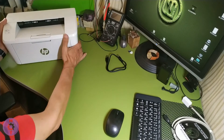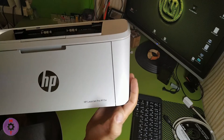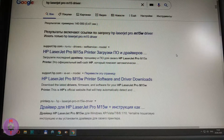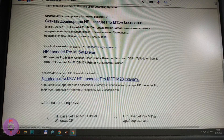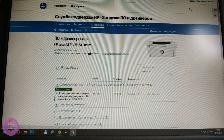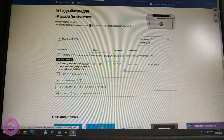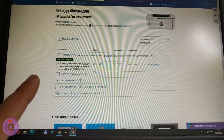We have a Hewlett-Packard printer — it says LaserJet Pro M15. We need this to Google its name along with the word 'driver.' Let's not get caught up in third-party sites like printer-p.ru or printer-driver.net. There is only one correct site: support.hp.com. The company logo is in place, as is the image of the printer — this is the original website of the manufacturer. You need to download the drivers from here. It's free and safe, which is most important. The site itself determines which Windows you have installed and offers the matching driver for your printer.